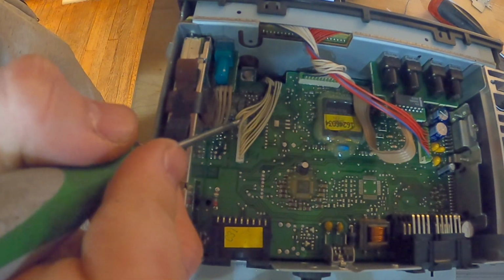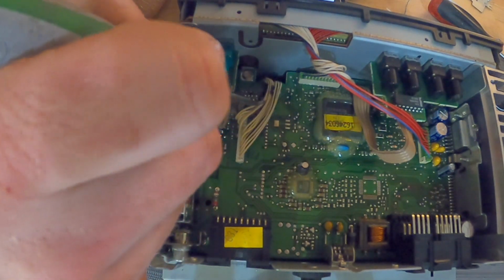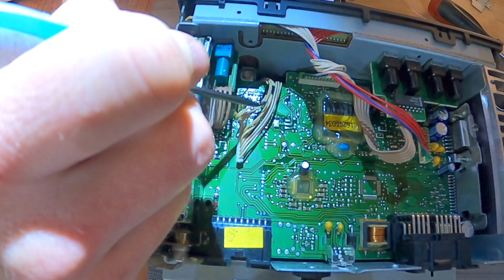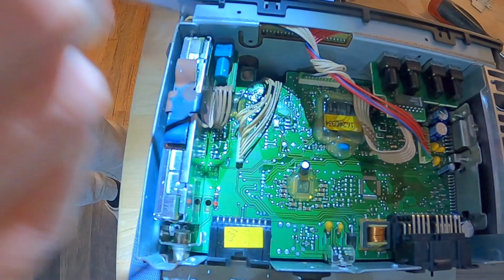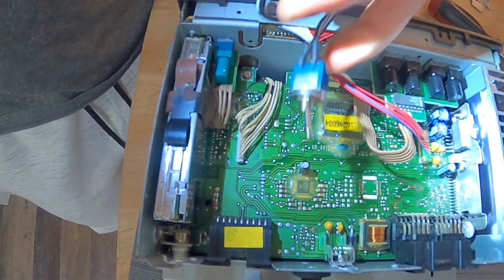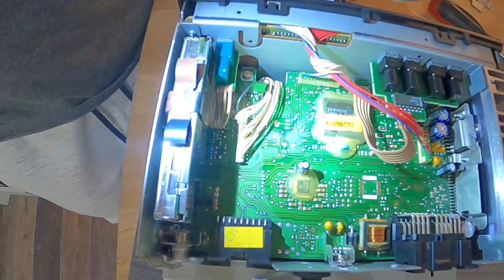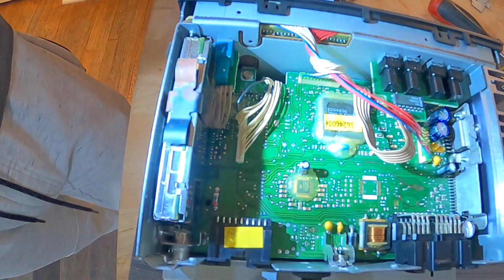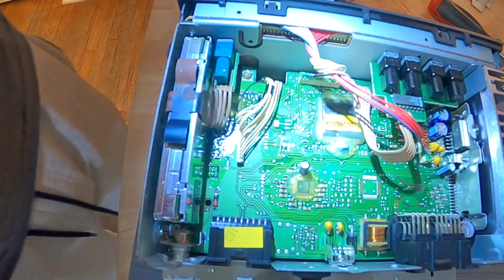The 7th wire on the connector, you are going to cut this in half with enough slack on each side, I don't know if you can see, so you can have enough room on each side to strip it, to take your 2-wire toggle switch and take the ends and connect them to each end that you cut. So you want to make sure you have enough slack on each end. So I'm going to do that first on the 7th wire, and